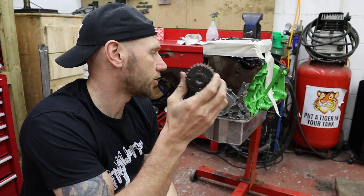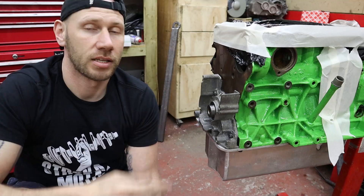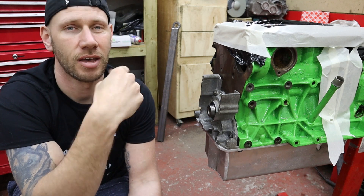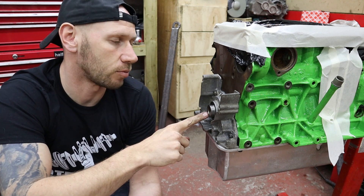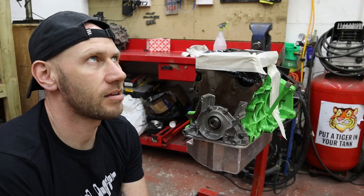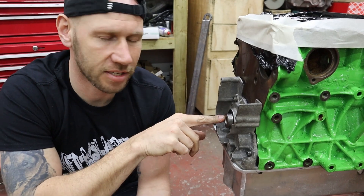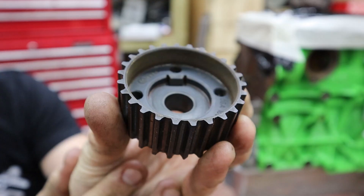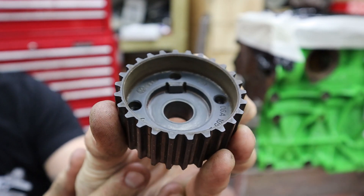Time to fit the crankshaft pulley. This is the crankshaft pulley and it sits on the end of the crank. It's the job of the crankshaft pulley to take the rotation from the crank and drive the cylinder head, the water pump, all through the timing belt. So you'd think that VW would make this a super strong part of the engine — no. This is one of those known weak points, all because of the keyway on the end of the crank. On the crank side it's actually quite strong, but on the pulley side that little keyway is known to be a weak point and can actually snap off.